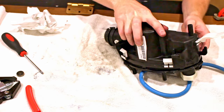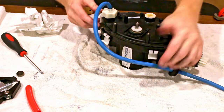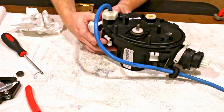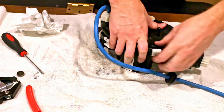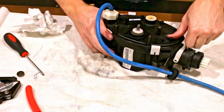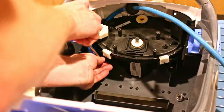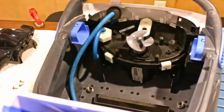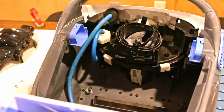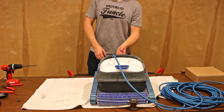Next, close the black box. Make sure you don't drop any wires around the gaskets and that both gaskets are pressed firmly onto the cover before reconnecting it. Apply pressure around the edge of the case until it's fully sealed, then clip it closed by hand. If you're forcing it closed you might be pinching the gasket. Then reassemble the unit — it's not as hard as it looks. You can do it with your hands and a screwdriver and it only takes about five minutes. Everything clips into place really well; clearly it's made to come apart and be put back together.